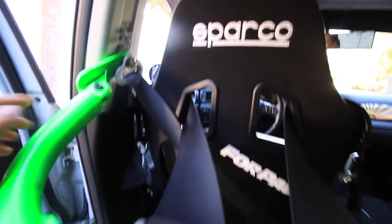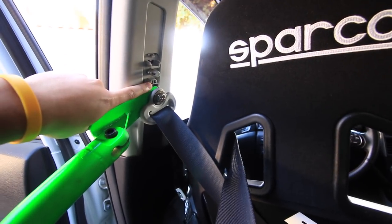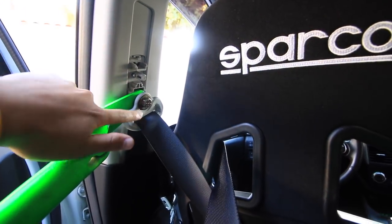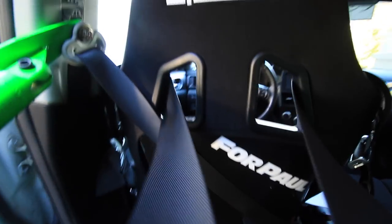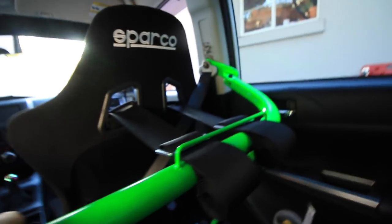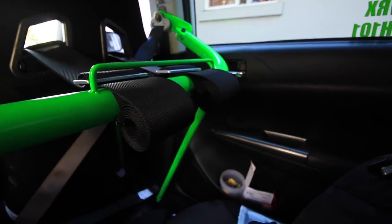And this is how it turned out. It bolts in right here. Unfortunately you can't use the seat belt covers unless you want to cut them — I did not want to do that so I left mine off. It bolts into the factory seat belt mount, and the seat belt can still work. It also goes to the bottom of the B-pillar and mounts all the way across. For the harnesses, I rolled them up and zip-tied them because they are really long and just hang, which is extremely annoying for passengers in the back.